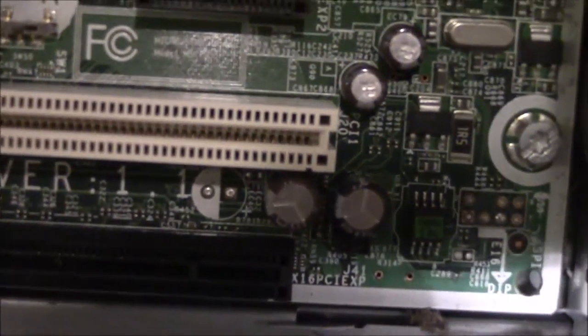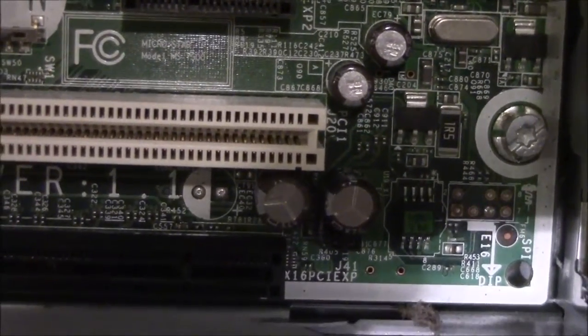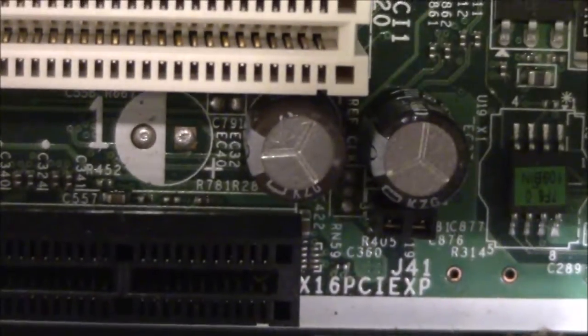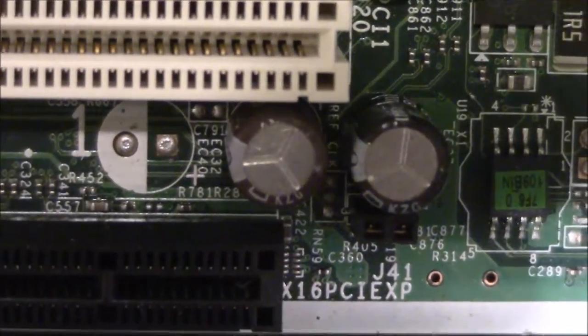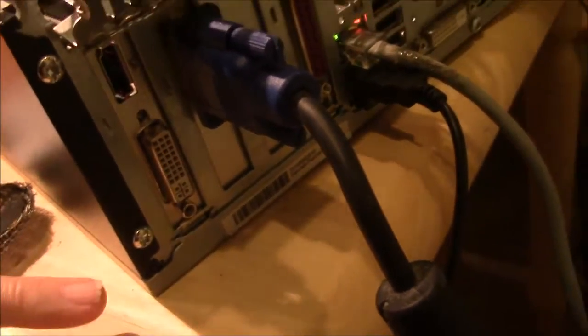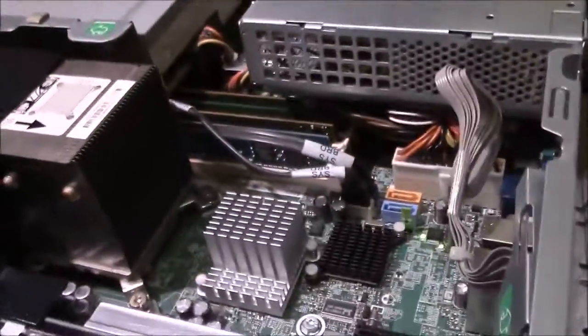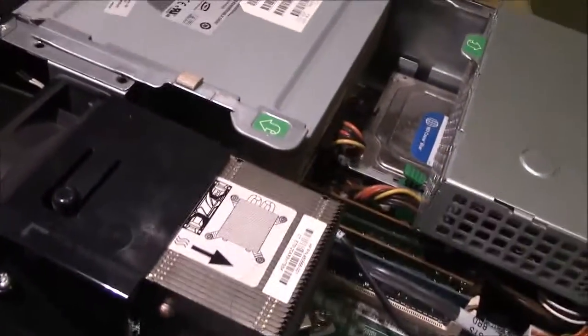You can see PCIe x16 right down there against the edge — right there. That's the expansion slot for it. So we're going to pop her in and see what happens. If you have the low profile, it's a little cocked up. You've got to put the card through the HDMI and the DVI-D on one slot, and you've got to unhook the VGA cable from the original slot, and then put it into the small one and put it next to it. We've got that set up, we'll secure the back.